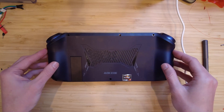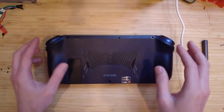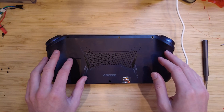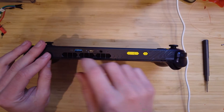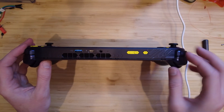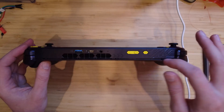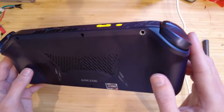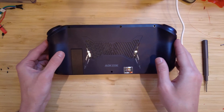It's not super hard. The back just comes apart with a couple of screws — it's pretty easy. The easiest way to pry the case apart is along the top, even though the bottom has that little divot for the stand. I can get my nails in there, but if you've got a prying tool it'll get in there. I've had pretty good luck with my nails and none of the case has been scratched.